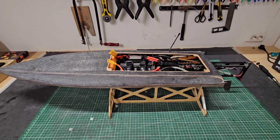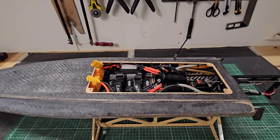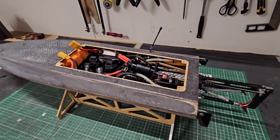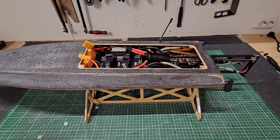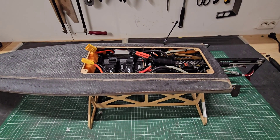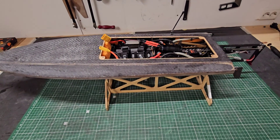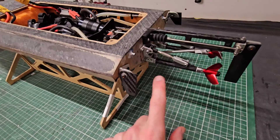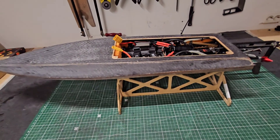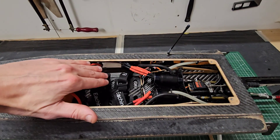The GeForce Twin Mono is back in the workshop. Today's run was really successful — I got a new speed record of 112 km/h. The boat ran pretty good; it is stable at high speed, which I really like because I want to get even higher speeds in the future. Re-watching the footage in slow motion, I noticed that these props seem to lift the transom and push down the bow, so the boat was running really wet. For the next time running these props, I will shift the lipos all the way to the back, because now I actually have them pushed to the front.